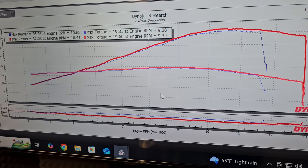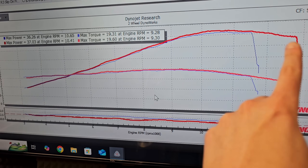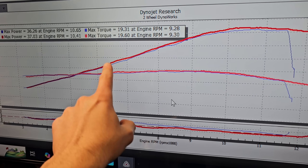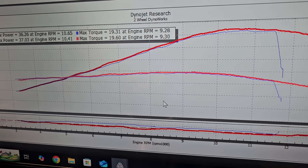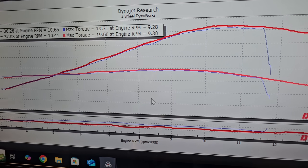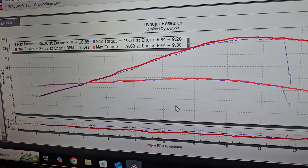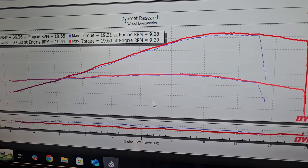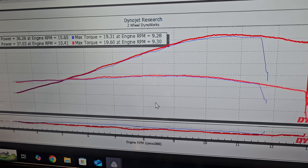But what's probably even more surprising to many folks watching this video is that once you do get the fueling back down to reality, get the proper ignition timing in place, and do the big rev extension that we can do on these bikes, you're still not gaining much with just a slip-on exhaust. Yeah, there are some spots where it was stupidly lean where you're picking up a decent amount of power — it's only like one or two horsepower, but on a bike that's only making 37 horsepower, that's actually a very noticeable difference. But at peak, you're talking about a whopping one horsepower. It is not a dramatic change even when you get the AFRs back to reality — the thing just won't run stupidly hot anymore or risk damaging itself.